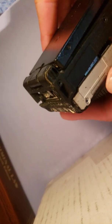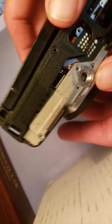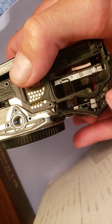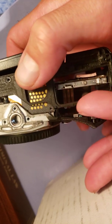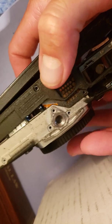Even though it's magnesium alloy or whatever they're calling it, I don't think it's as durable as you might believe. This one has been dropped and there's actually a crack right here. That's probably more than it was meant to take. Also when you're opening it, be careful because the little battery retainer will sometimes hold in part of the lip and keep the pieces from coming apart.